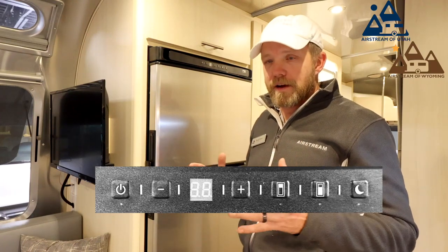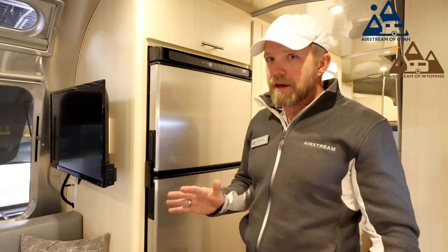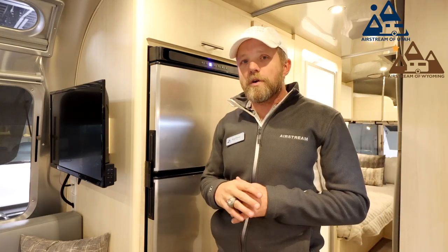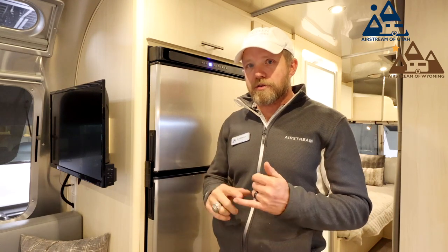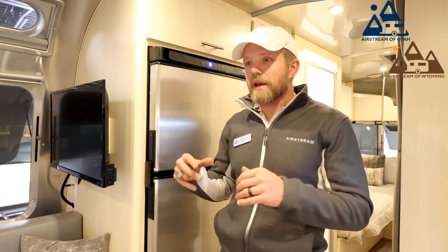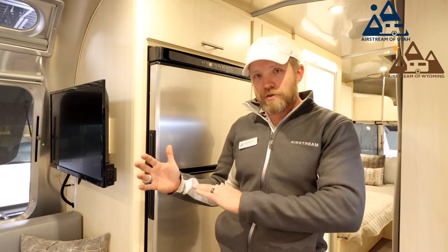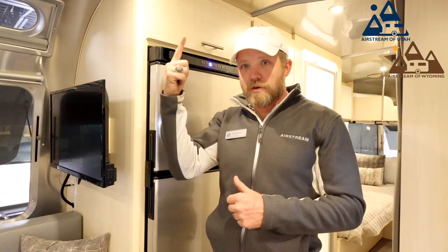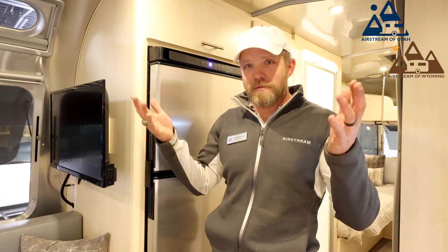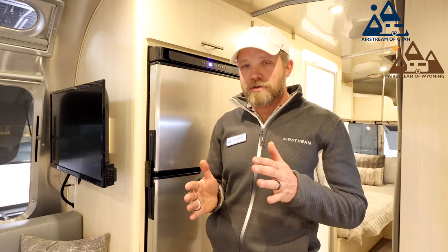There's also a night mode button, which is really great. As you're going to sleep at night, you push and hold the night mode button — the light comes on, meaning it goes into night mode. It slows down the compressor and the fan inside to reduce energy consumption, and it's also quieter. Before activating night mode, you need to have the fridge cooled down. After eight hours, it automatically goes back to full mode. You can also manually turn it off, or adjust the hours via your owner's menu.